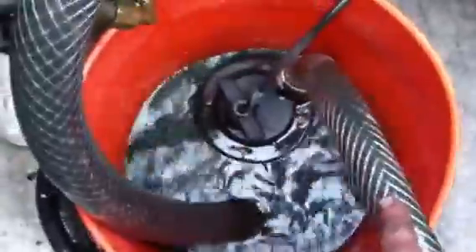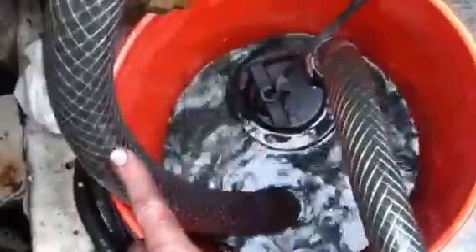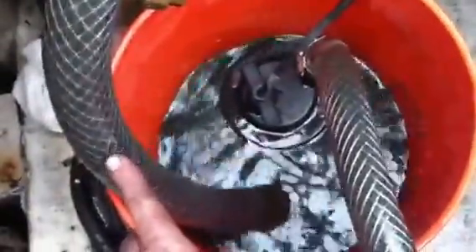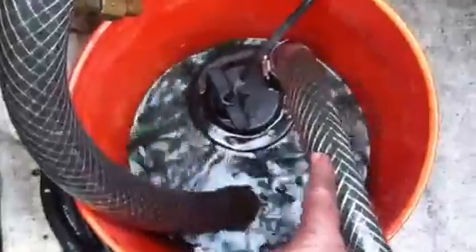You also need a pump — I'm using a little cheap sump pump from Home Depot. I'm using one-and-a-quarter inch line coming out of my oil cooler as my return, because I'm back-flushing the system — going backwards as opposed to the normal flow of the raw water circuit — simply to get a better flush. The one-inch line goes to my exhaust manifold. The circuit starts there, comes down, loops through the heat exchanger, down through the seawater pump, back up through the intercooler and engine oil cooler, and exits out the oil cooler.